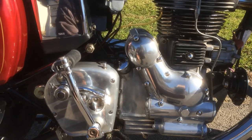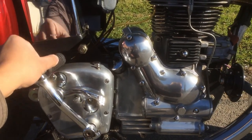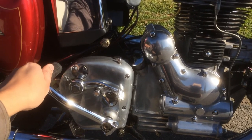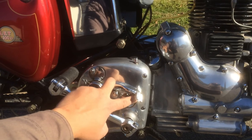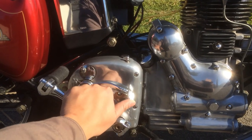Because it's an iron cast engine, it produces a very unique noise that's not present in the modern Royal Enfield. That's the kickstart. Kickstarting this bike required a level of skill because you'd have to use the decompression lever to put the piston up to top dead center — I'll explain that later. That's the neutral finder, something you don't see in modern bikes anymore.